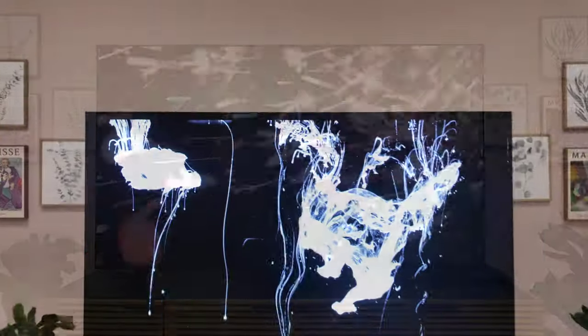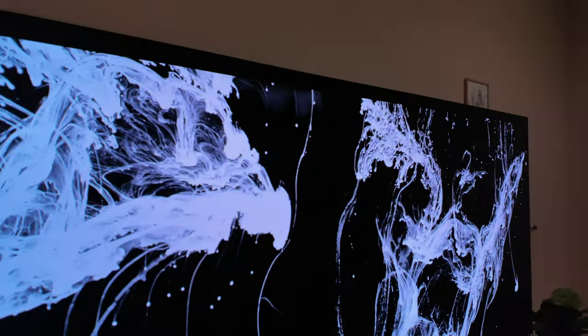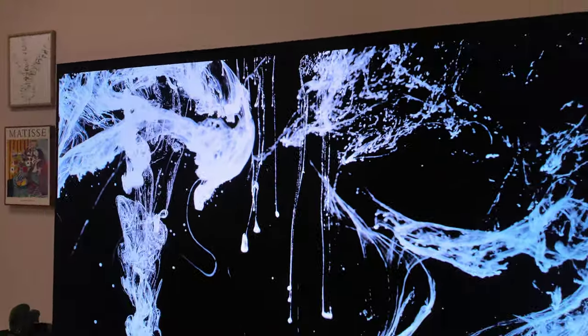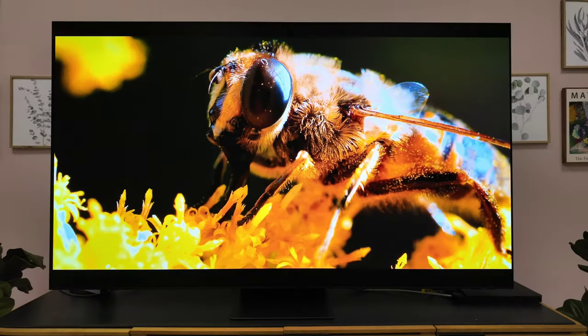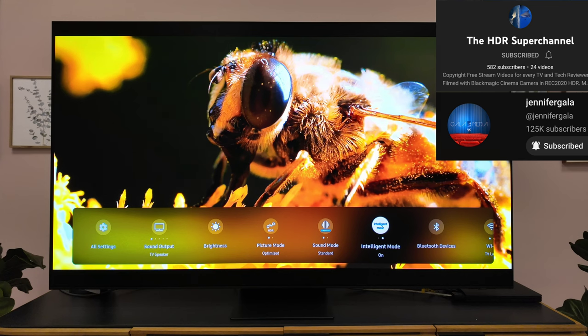This is a very tough demo coming up next, and it's going to appear very cool on camera, but it does not appear that way in person. This is usually a very hard demo for many LEDs because of local dimming — the test is to see how the QD OLED handles white and whether it blooms. And it does not. It looks absolutely amazing both in light and in dark. There is one instance where I had the star field up, and the very small details did behave like a mini LED. You did not see the stars sparkle the same way as a regular QD OLED or WRGB OLED — it looked like it was blooming, but it wasn't as tack sharp per pixel as you'd expect. That's the only time I noticed that the coating was a little bit of an issue.